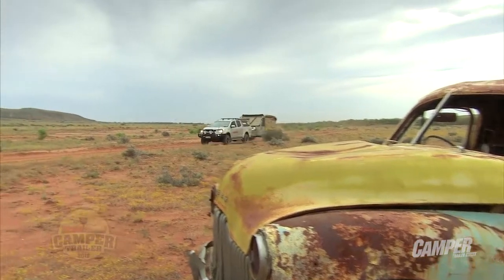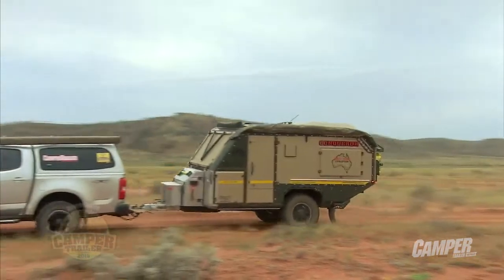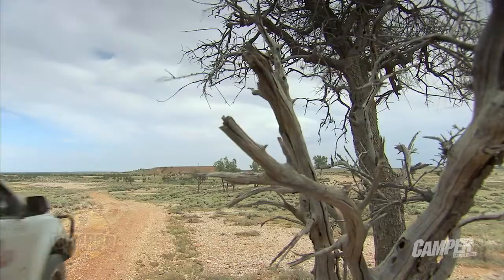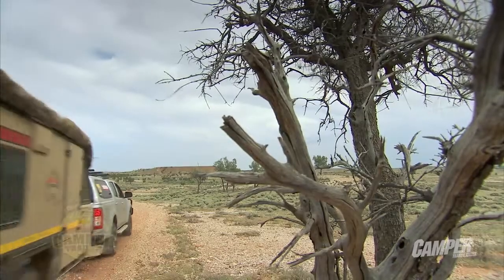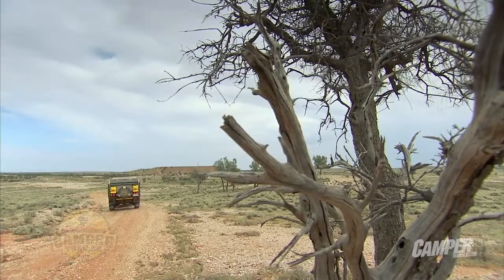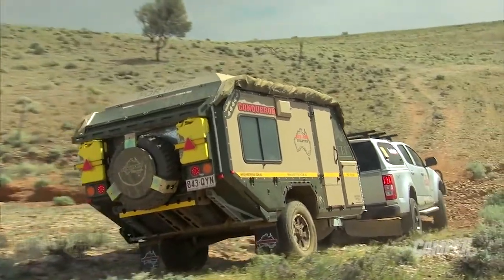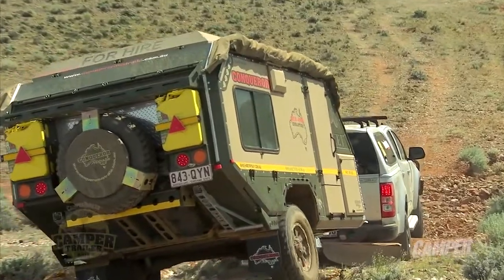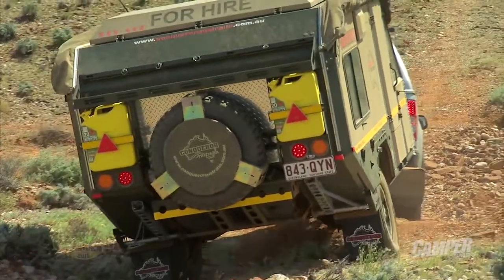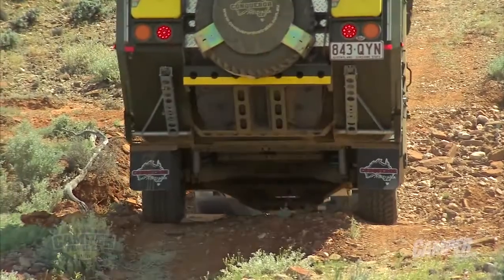The other thing that people want in Australia — of course the South African model comes in with override brakes, which is great for the higher market, terrific for simplicity, no doubt about that. It's a smaller, lighter unit made for maybe your state forests and your corrugated roads. It's still a rugged unit. But this is actually made for no roads, so full electric brakes — which obviously you've got full control from the towing vehicle. Lock them on, lock them off if you need to. You've got full control over them. Electric brakes — much better option for Australia.